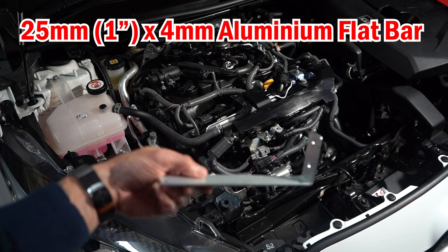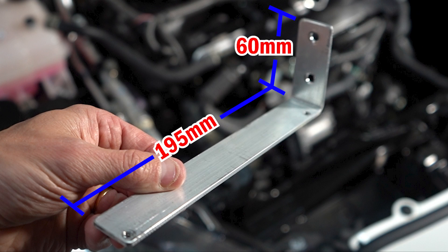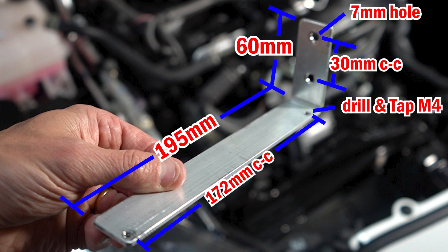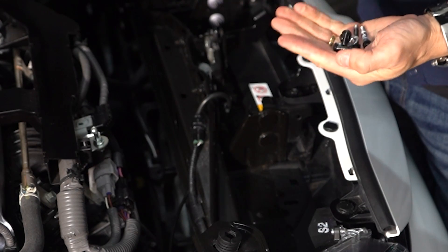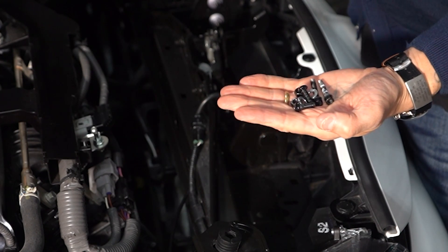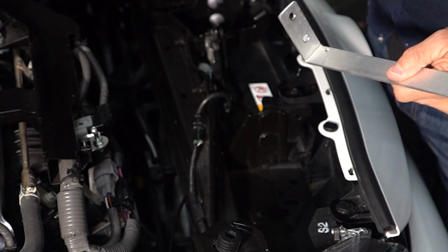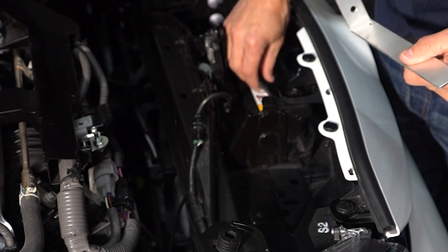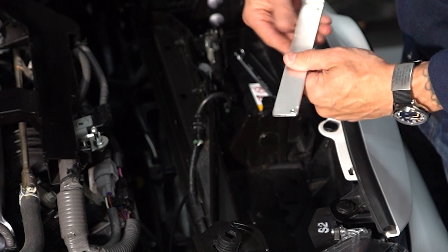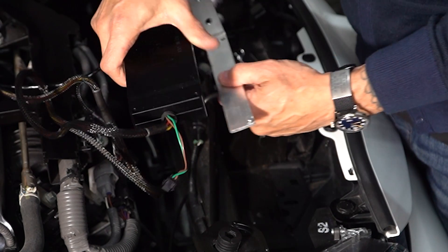Here's the bracket I've made — it's just a 90 degree bracket with holes pre-drilled and tapped to mount the JB4 box. I'm using hex fitted bolts and 10mm nuts, so all metric fittings. You just need a 4mm hex wrench and a 10mm spanner for install. I'm going to mount the JB4 onto this and leave the cables laying about until I know exactly where I'm going.